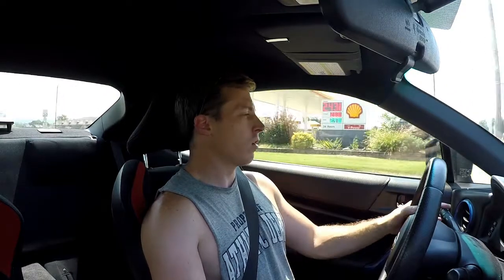I don't know how many of you this is your first car or all you've driven is new cars, so this might be lost on a lot of you. It feels like an old truck clutch at the very end — it's not slack, but there's just a little bit of play. About a quarter to half inch of the pedal at the very top where the pedal's completely out — there's a quarter or half inch of non-clutch engagement, if that makes any sense. If you own one of these cars because you actually like driving it, take 10 minutes and remove that spring. That's the takeaway: remove that spring. It feels like the car now.